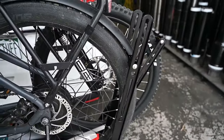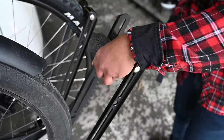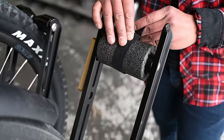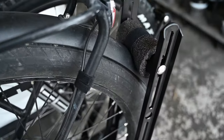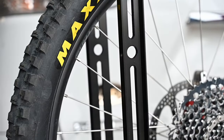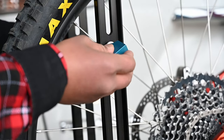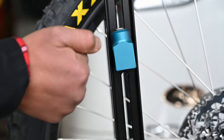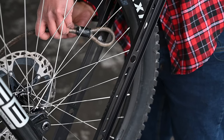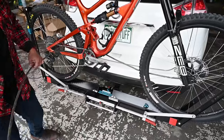If your bike has fenders, ensure the tire spools contact the tires above the level of the axle. If you have long fenders on your bike and are worried about cosmetic damage, we recommend a small piece of pipe insulation paired with velcro to provide protection. In 20 years, Cal has never had an issue securing bikes over the fenders this way. To secure your bike on the Mach 2, you can use our wheel lock accessory. These cylindrical locks install into the rack swing arm and through your wheel set. The lock is designed to face downwards to prevent weathering. We always recommend using these in tandem with a cable lock running through your bike frame for higher protection.